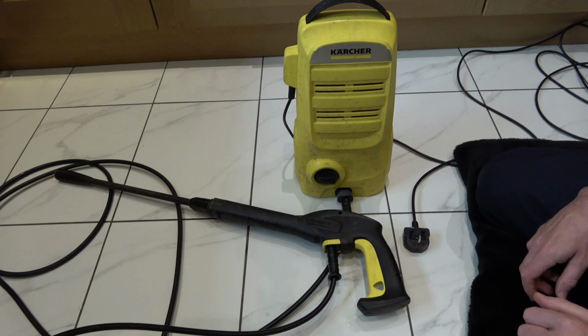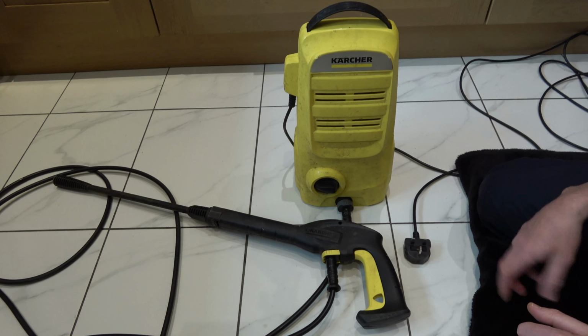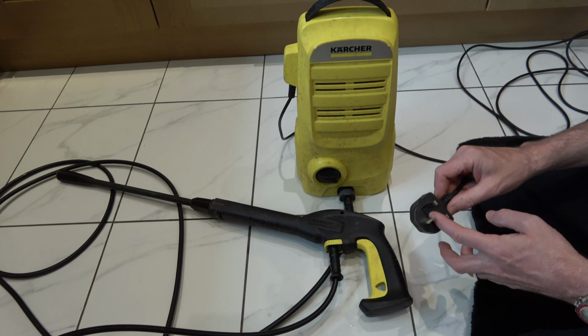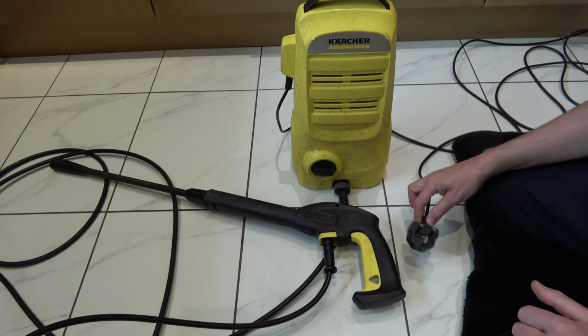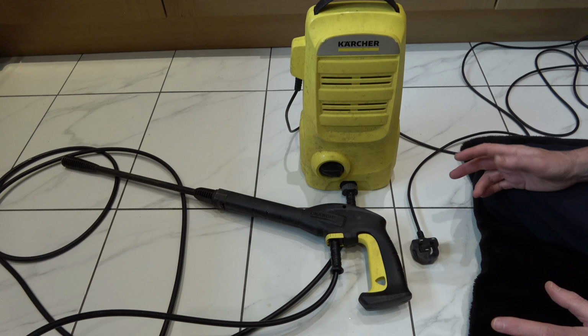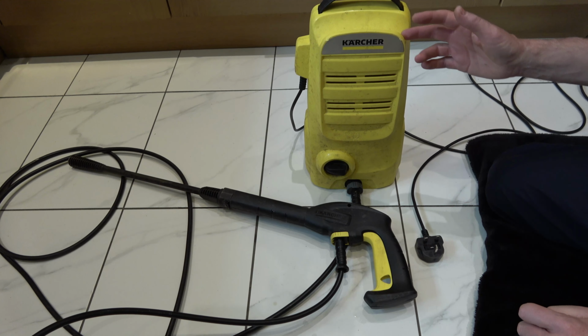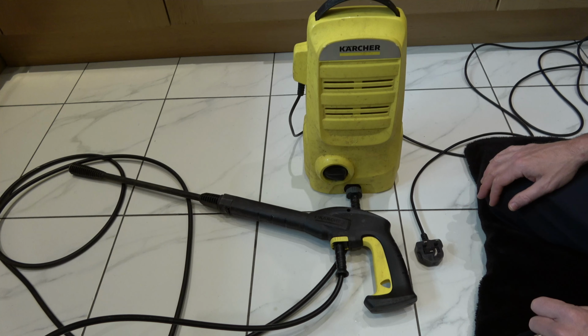Hi, in this video I'm going to show you what you can do if your KARCHER K2 Compact is not working. Obviously, first things first, you can check the fuse. Hopefully that will be okay. If when you plug it in it's not doing anything, it might have an airlock. So try this before buying yourself a new one or putting it in for repair.